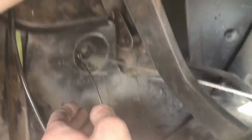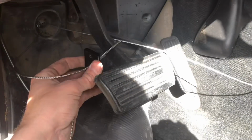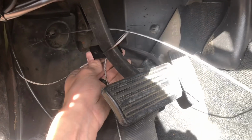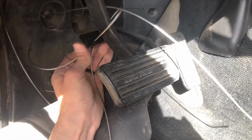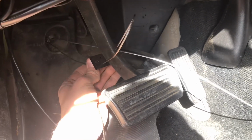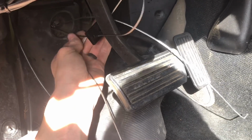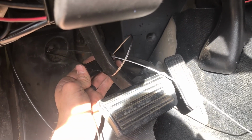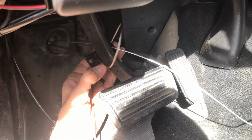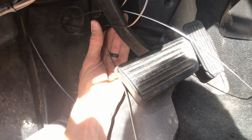Now that it's run through on the inside here, again through the rubber deal, we're going to crisscross it through the other way on this plate. Now, of course, the ready brake plate, we want it to be fairly tight, where there's not a whole lot of slack in it, but the Breakaway can have a little play in it. So let me put the camera down, get this fixed up here. I'm going to cross both of these wires, run them through the little holes, and then put this other plate on here and bolt it down right about here.